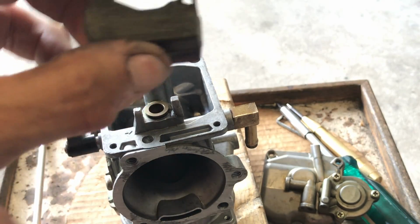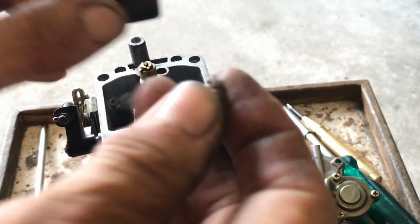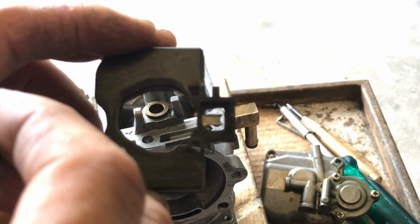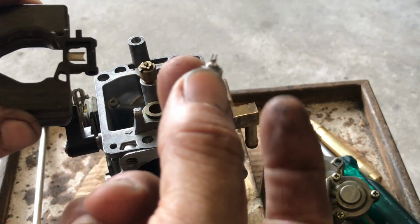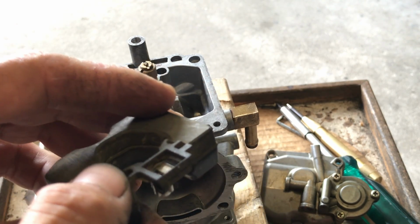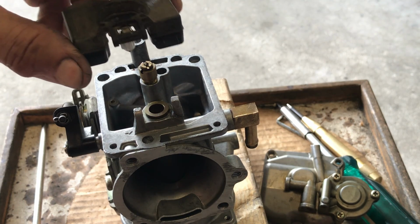All right, now we got the float. You'll see this little tang right there. Do not bend that. You got to know something else is wrong. How would that bend? How would that get out of adjustment? It's just not. Usually this is your problem. If you have to, just buy a new needle, $22. Leave a comment and I'll send you the link to where to buy these pieces.